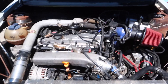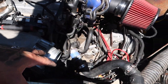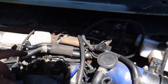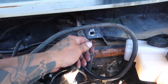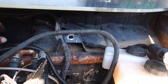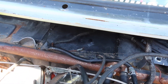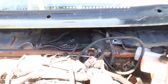Sit-rep: I've got all the wiring plugged in. I'm gonna put the pipe on and hook that up. The ECU harness that goes up here needs to be grounded, so I'm gonna drill and ground some wires up here - maybe over here, I'm not sure where it'll reach, but I'll drill and put some bolts in somewhere up here and then on the inside.